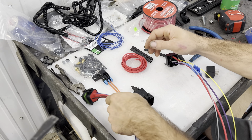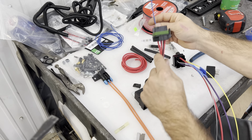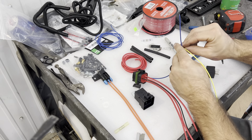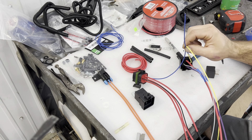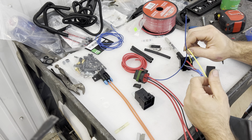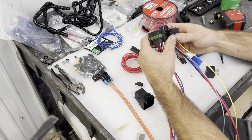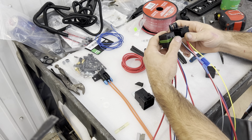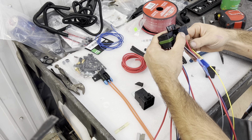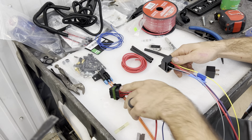The feed that comes out of the car — this blue wire — is the on signal. I'm going to loop all of these trigger wires together so they all get fed by the factory fuel pump on signal. That will simultaneously kick all three relays on. They'll be running at all times, which is fine since we're not doing standalone with two-stage control. If you want a clean wiring job, first figure out how you're going to mount the relays so you can wire them in parallel while they're next to each other for a clean look.